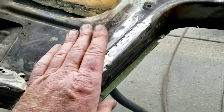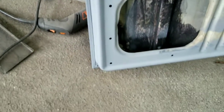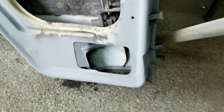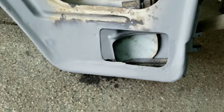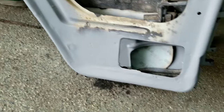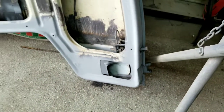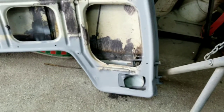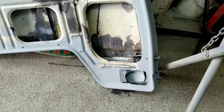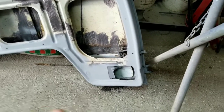Let's look at the other door. I'll show you what that looked like. I just did a quick fill on here, and I put some spray can primer. It's like the 2-in-1 from Transtar, but I use the one from Medallion, which is a lot better. And I just threw a quick color filler on here. That's not finished again. It gets sanded down and then real primer and built up, block sanded, and then finished. A little bit of glazing on it, whatever. But that's kind of how that turned out.